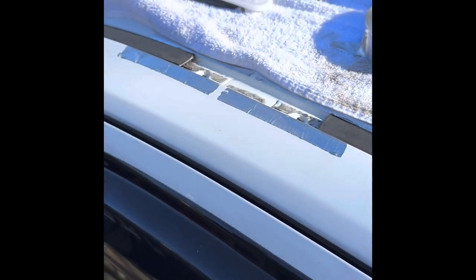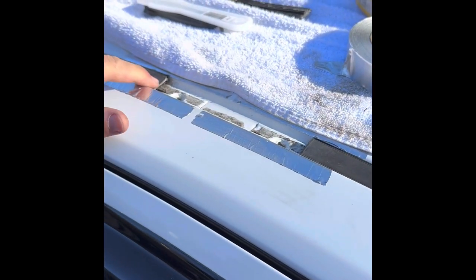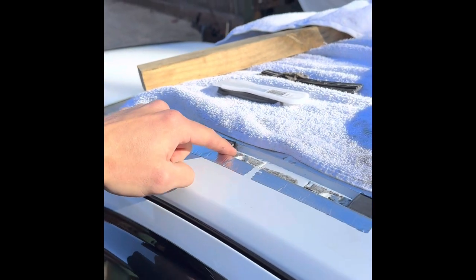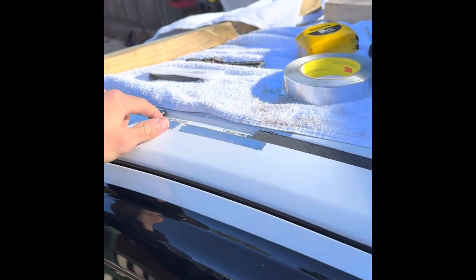I'm going to do the rear now. The measurement for that — from the original 230 mil mark you made at the front, you want to go 1190 mil, and it will give you a little mark there. That's the rear mark now, and then I'll come forward from that, which will give me the holes, and I'll line up the bracket so I should know where they are.